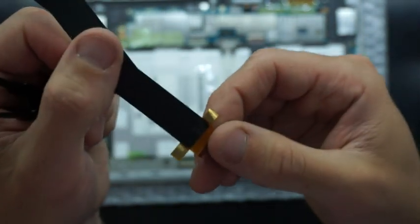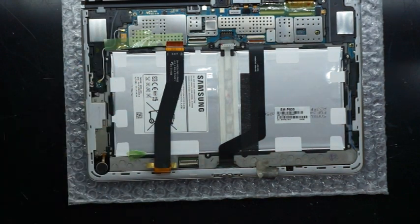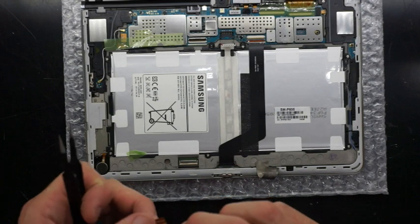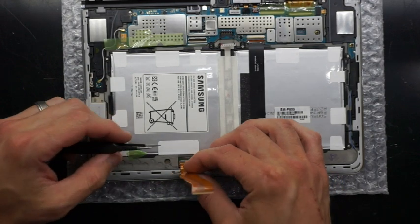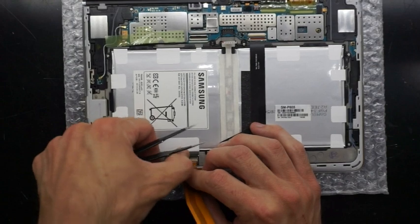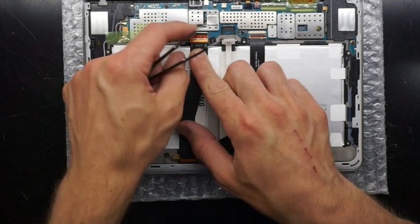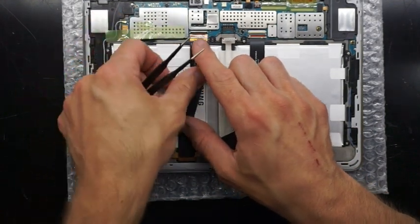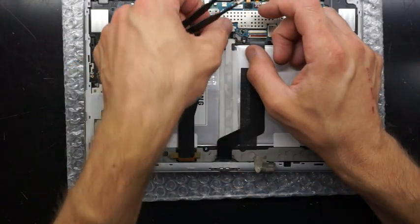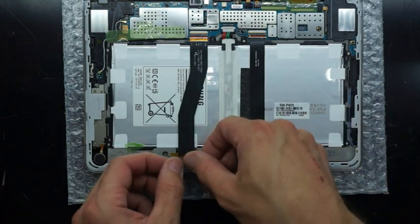We'll take it out and give it a little bit of a fold. Then I'm going to put it back in. It is a little bit tricky to get it to initially go into the clip itself, so I'm going to use a pair of tweezers to aid me in that. And that got it — the top one is now in. From there I can pull the latch down, reconnect the battery, and put the tape back in its usual spots.